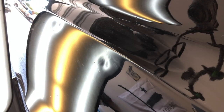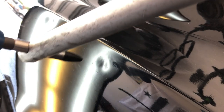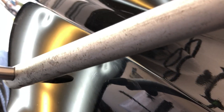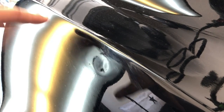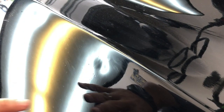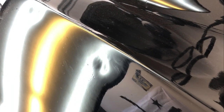Every repair has its set of challenges, but this classic car had its own set of unexpected challenges. For one, it's completely open with no place for us to gain leverage on the inside. So I'm using a blending hammer from the inside technique, but as we knock down on the outside, we noticed that the aftermarket paint job never cured correctly and is leaving divots in the paint from the slightest knockdown. Most paint jobs are extremely hard and we're able to knock that metal back in without damaging the paint at all, but for this one I'll have to use the rubber end of our knockdown for the outside work.